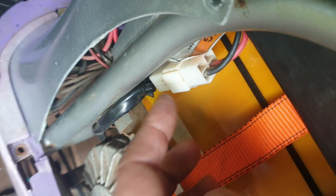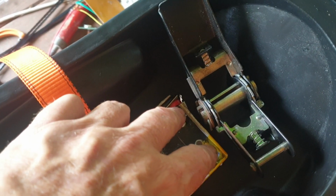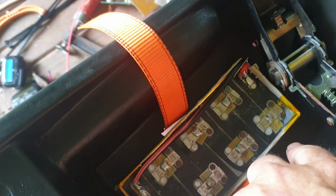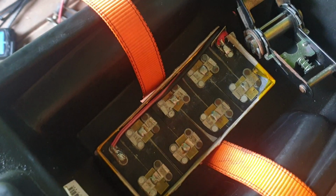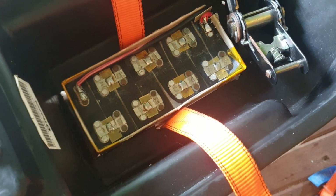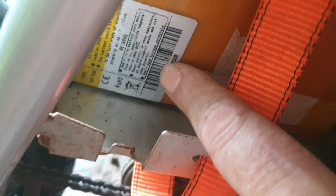So just unplugging that allows me to remove the battery, and then I'm charging each cell on lithium iron phosphate at 6 amps, and it's taken an enormous amount of juice to get it to the point where they've filled up. Each one of them was swallowing anywhere from 3,000 milliamp hour units to, like, one of them swallowed 6 before it filled. The entire pack says it's a 10 amp hour pack, so I'm not real sure about whether it was actually what it was meant to be, because down there it says, that's the old sticker. You've got to remember there's 4 cells removed.